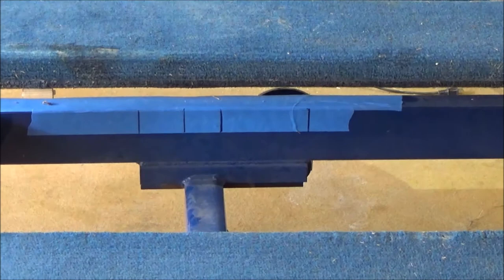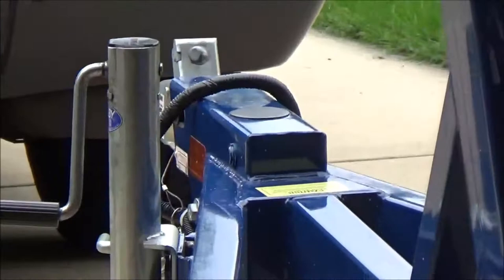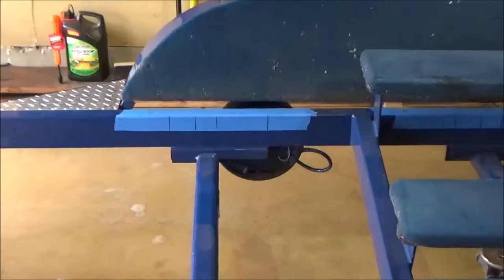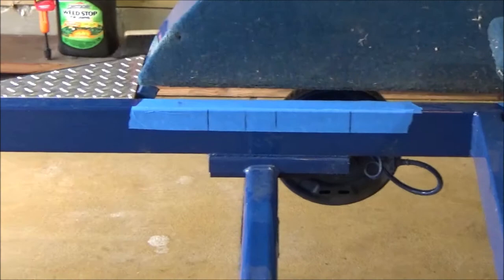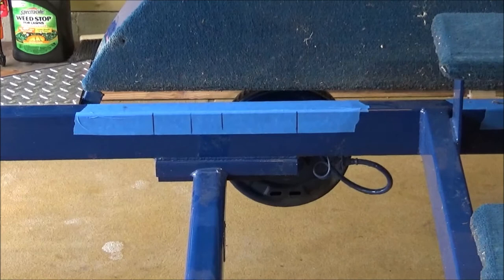But when it comes down to it, we're going to mount this rear axle first. Once we tack up one point in roughly that position, we're going to have to triangulate from there to here. We'll have the truck hitched up, and we have to be right off the center of the bottom of the ball so that we know the axle is pulling true, and then we'll go forward. We're going to have to do the same thing for this one, only this one I can't necessarily drop it and pull it out of the way. I could if I want to disconnect the hydraulic line, but I'm going to try and do this without disconnecting the hydraulic. Since I just bled that out, it's brand new fluid and the brakes are working perfect. I'd like to not mess with that.